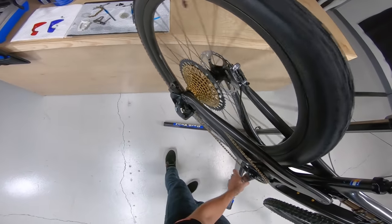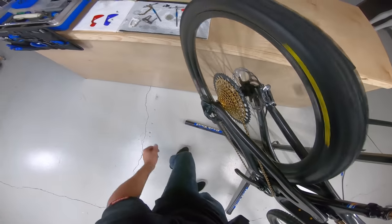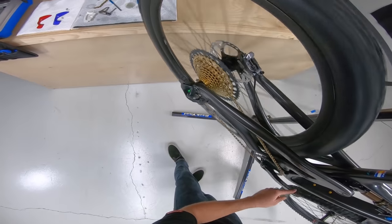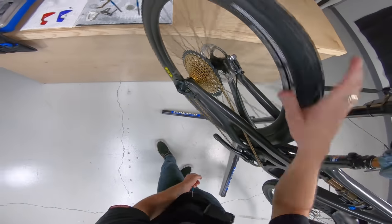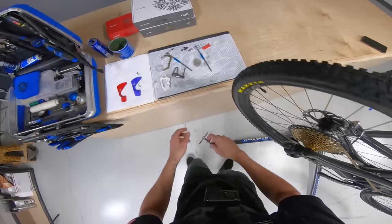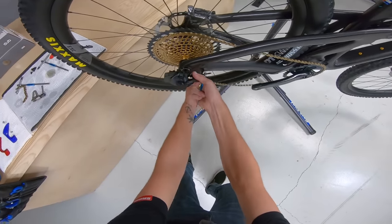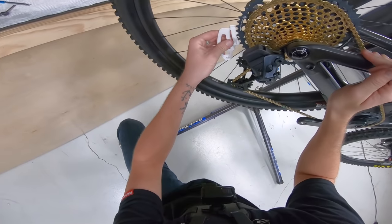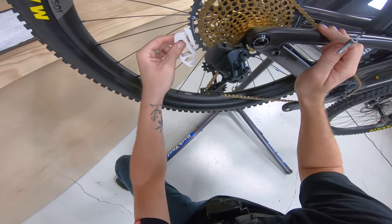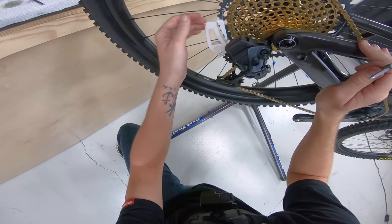As you shift up, you can already hear it's touching there. So I'm going to add a couple of turns just so I can get up there without too much scraping. We're going to live in this cog to do our adjustment. You really want to do this adjustment under sag, but when a bike is being built brand new, I just do it in the stand and then readjust it with the rider under sag later, because under sag this tends to move a little bit.